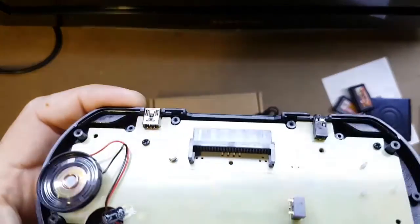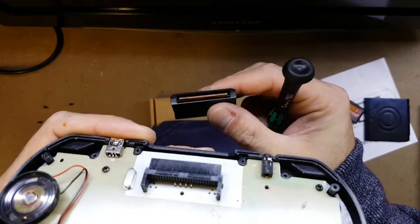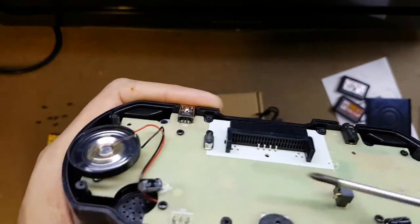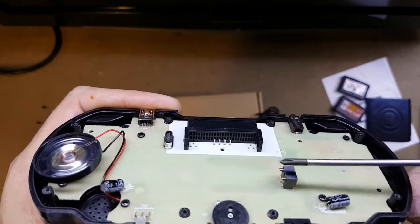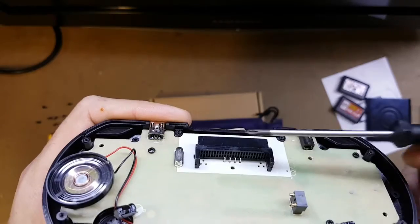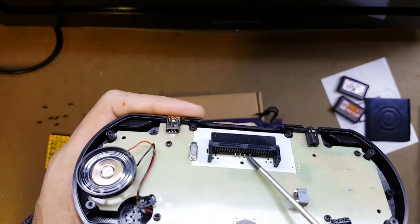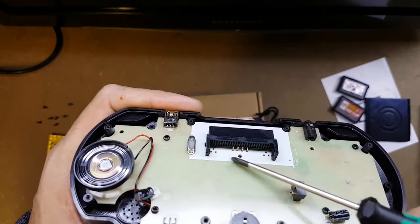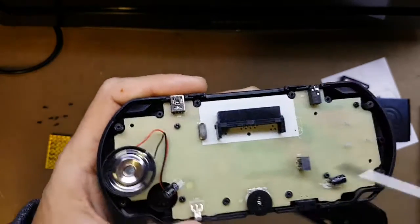Now that might answer my question. In a previous video I showed you that inside these cartridges there is absolutely zero electronics. So looking at the cartridge connector, there are only four connections. So what I said about modifying it so you don't need to use the cartridges and just flicking a switch — that should be fairly easy to do. I'll crack open both cartridges and work out which ones are controlling the menu system.